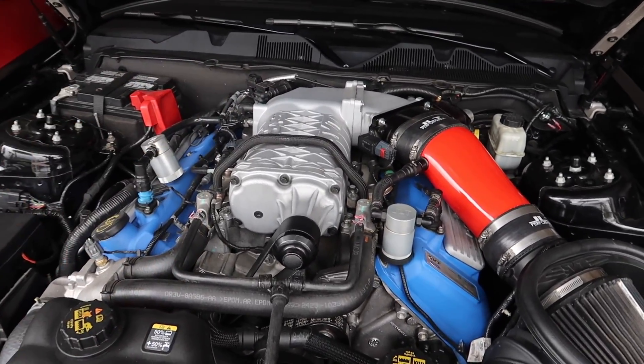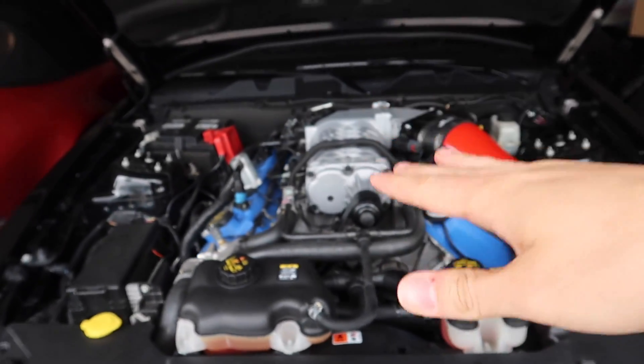There are different build options for this 5.8 liter. The weak point is the block, so if I just resleeve the block I should be good for 1000 wheel horsepower — that's really all you need. Or you can upgrade the rods, pistons, and everything else, which would set you up for 1500 horsepower. I'm not entirely sure if I want 1500 horsepower as a daily driver. So I'm really thinking about just resleeving the block and reaching 1000 wheel horsepower. Comment down below — should I go for 1000 wheel and seal the deal, or go all out and hit 1500 wheel? It's going to be about $6,000 to $10,000 just for the parts, and I'll be doing the build myself.